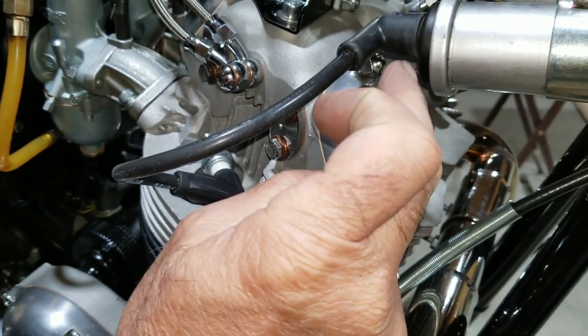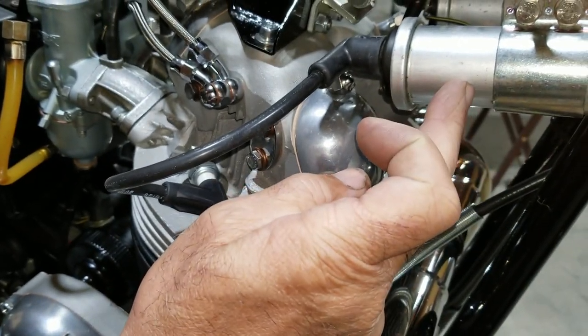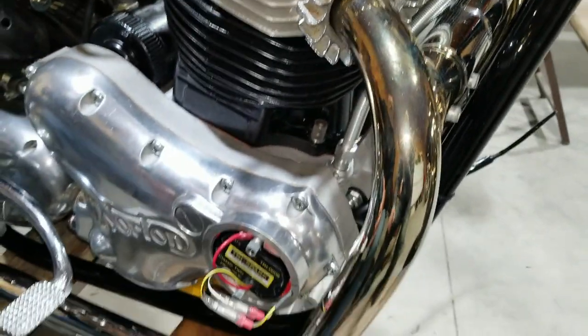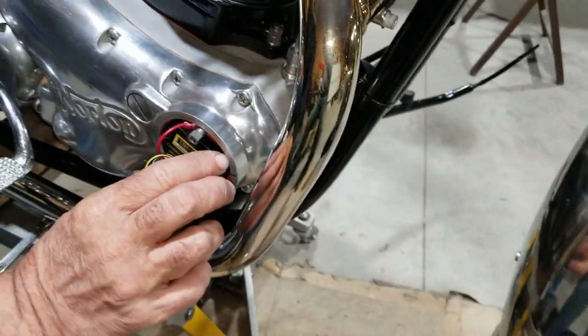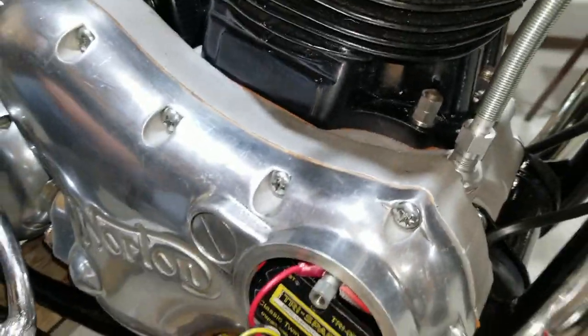And it's hard on the coil not to have it complete the cycle. It'll try to arc the spark inside a coil, and that's not good. It'll short them out. So, with that all in mind, we're going to set this up just like the procedure book says. It comes with a tri-spark, and then we'll have to revisit it once it's running.